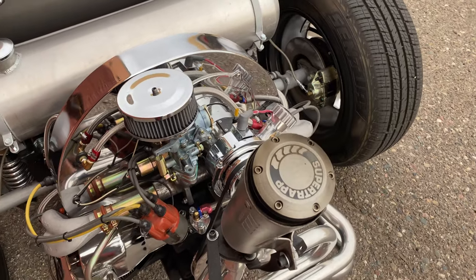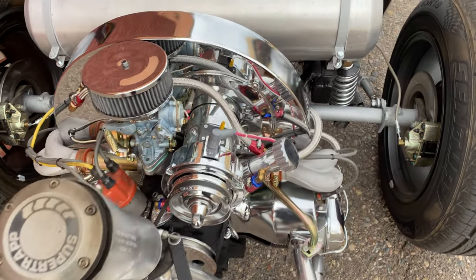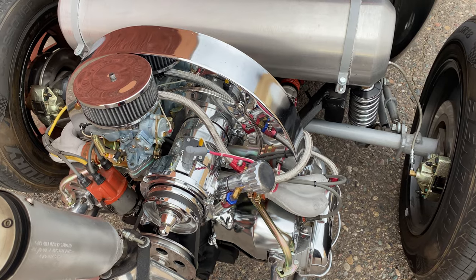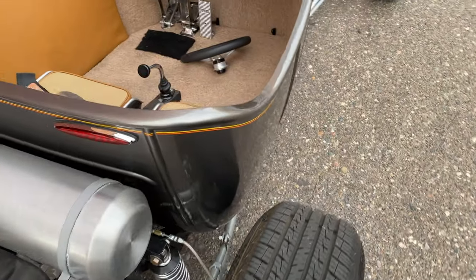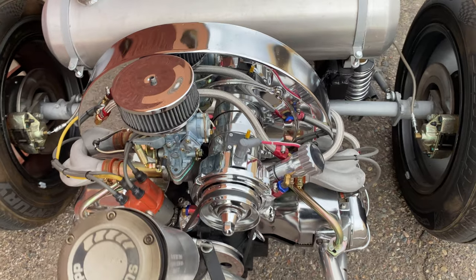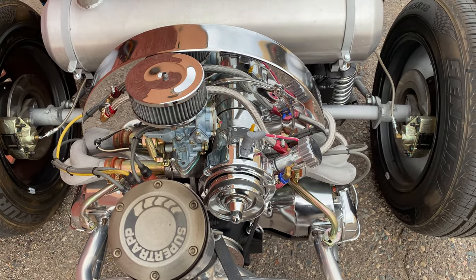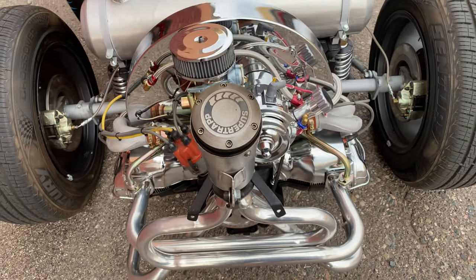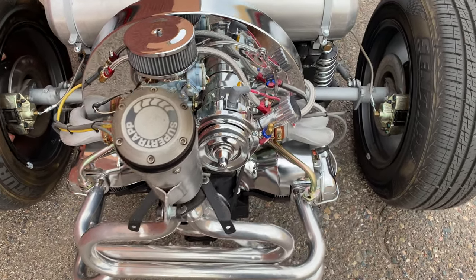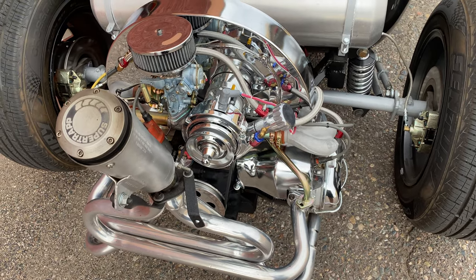As for right now, you could put in a Ford Pinto, the Ford 2.3-liter Mustang, or the Thunderbird turbos — Dan Esslinger makes those little 2.3-liter turbos that totally scoot, and then you'd have a Ford motor in a little Ford roadster. If you're looking for more power at a lower cost, the next option is a Chevy Ecotec — 2.0s, 2.2 liters, 2.2-liter turbos and superchargers, 2.4s and 2.5s — used in the Chevy Malibu, Cruze, Cobalt, and HHR. The Pontiac Solstice and Saturn Sky used 2.2-liter supercharged motors.